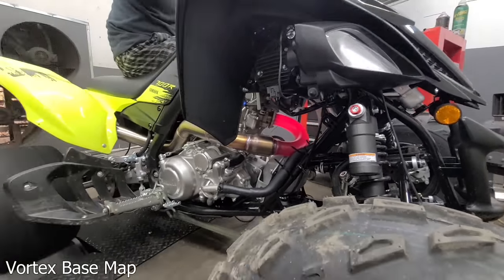And just looking at that graph up there at that 2 to 3,000 RPM range, it dips way low. Oh, well, that's under full throttle. But that's way too huge of a dump of fuel. It's way too lean at 2,000. It's way too rich at 2,400. We had a lot of work ahead of us. Well, that's good. But they say, don't touch that tune. It's perfect. Perfect tune.